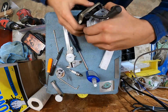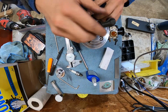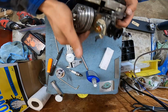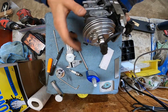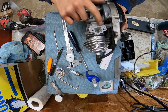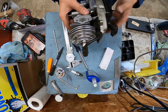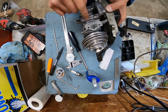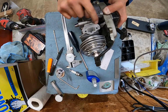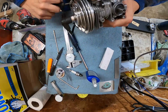Oh man. Of course, there's a grommet for the factory cover that we're not using. There it is. I remember with these, you got to trim the bottom of this for the pipe adapters because of the way the springs line up. They actually hit, and they make the spring sit all goofy. So I end up trimming these a little bit for a pipe. But yeah, this thing's gonna be gnarly.